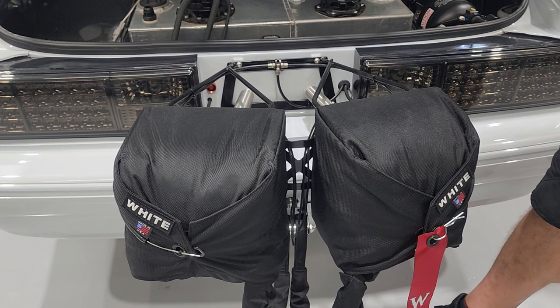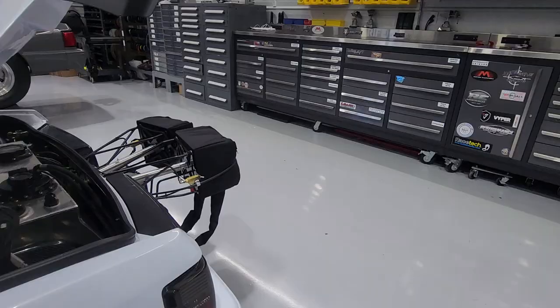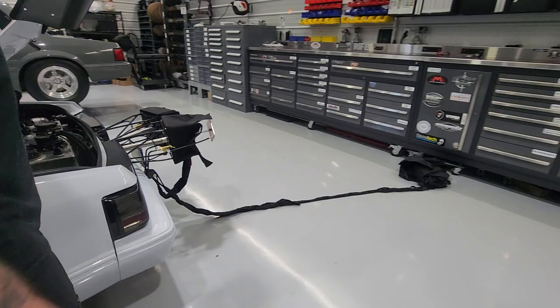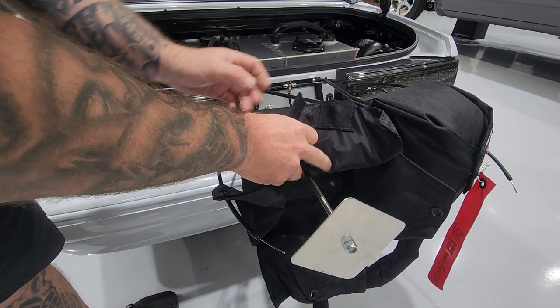We still have 100 psi up front for boost control and for the shifter and chute handle, but I'm going to mechanically just launch the chute handle. Step off to the side - this is what it looks like at 200 psi. Hopefully it's awesome. Oh my god - there you go! So now over here, this is charged with 200 psi. You throw the air valve, releases all the pressure, you can push it back in and repack the chute.